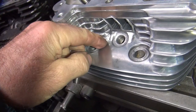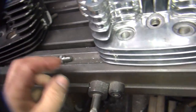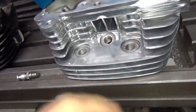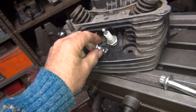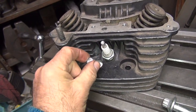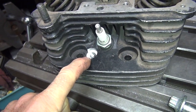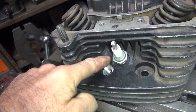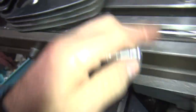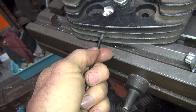If you put it right here and just stopped it right there on the top surface, it would look a lot cleaner than having a big hole going down in there — this is high, this is high, and that's low. So let's try to avoid doing that. The problem is there's not much material over here to work with; this location is very precisely placed because it's very critical. We have the problem with the port on the backside and the hole coming through on this side.